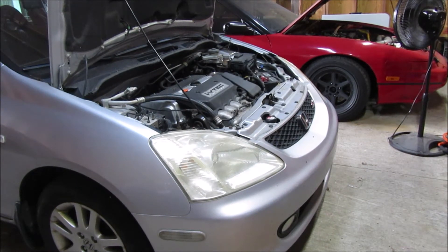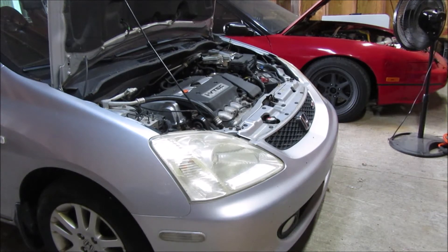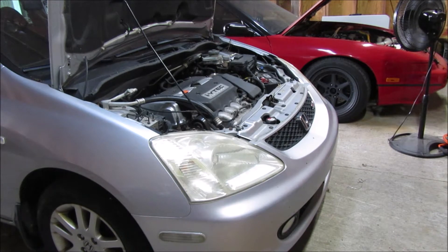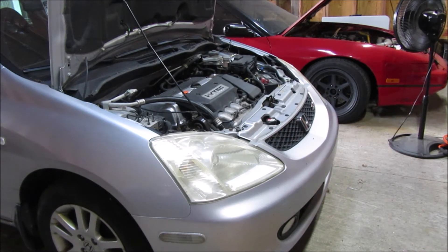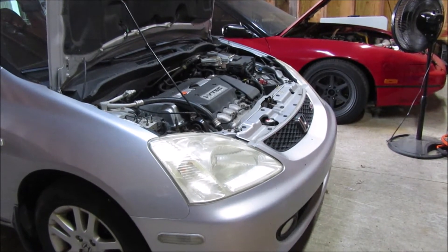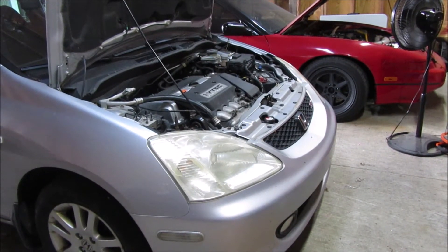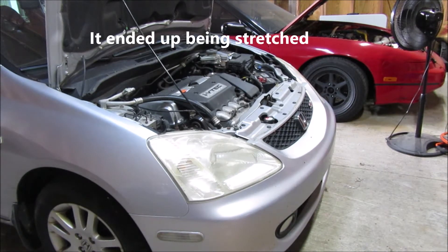The other day when I was dropping off my daughter, I dropped her off, started up the car, then about half a block away at a stoplight, the car just shuts off. I turn it back on, it cranks a long time, it starts, but I have to keep gas on it so it doesn't die. I limped it to work, got my code reader, and got a P0341, P0301 through 4, and P0300 — basically a cam sensor code or crank sensor code along with misfires.